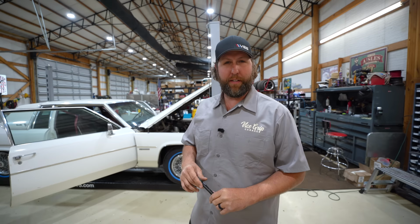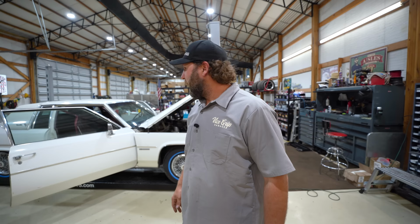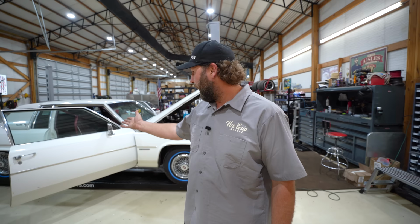So a guy just pulled that computer out. Let me tell you something. If any of y'all was a dealer technician back in the early 80s, mucho respect, okay? First of all, how do you fit your hand in there? Third of all, what are you looking at? You know what I mean? Anyway, I don't think I broke any of the connectors and the PROMs are still connected. So now I'm gonna transfer those over to the new box and try to get that in and reconnect the connectors that I couldn't see or feel previously. Then I guess we're gonna try to fire it up, right? Because that'll fix everything.